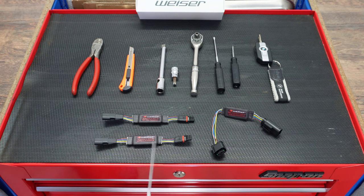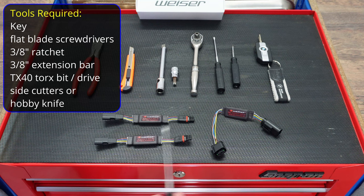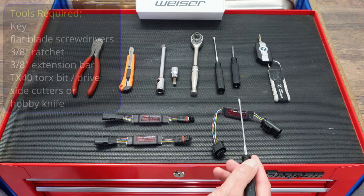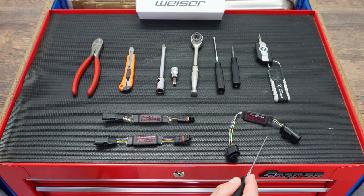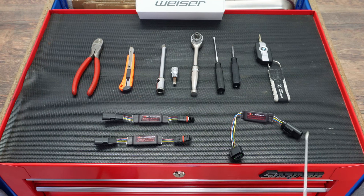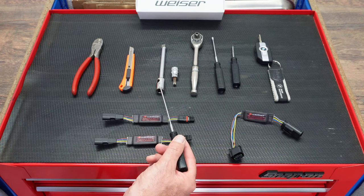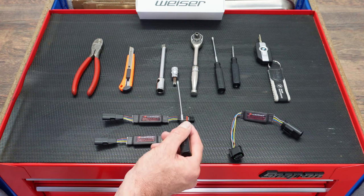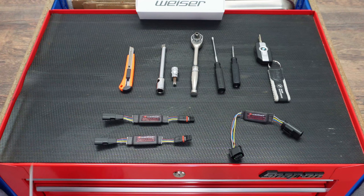These are the basic tools we need to install the three rear modules. Bear in mind the two indicator modules are not handed — you can fit either one to the left or right, you can't get this wrong. The run-on module is not essential for the indicators to work; it's optional but adds additional illumination to the rear. We need the ignition key, two flat blade screwdrivers, a 3/8 ratchet, a 3/8 extension bar, a TX40 to remove eight bolts, and optionally a cutting device or side cutters.